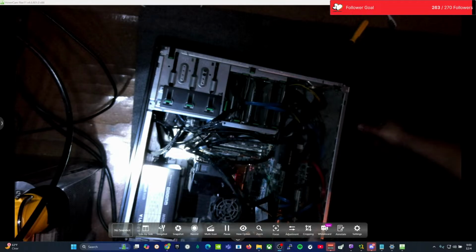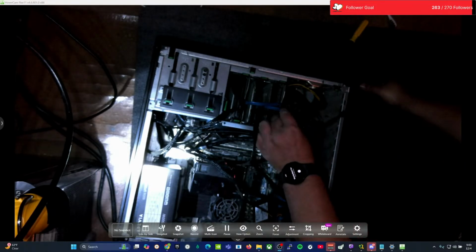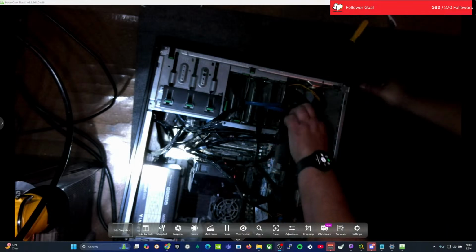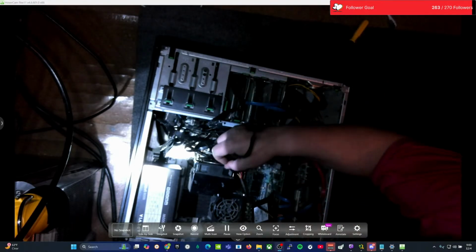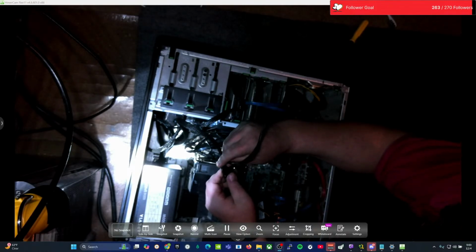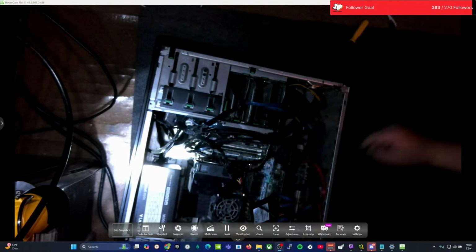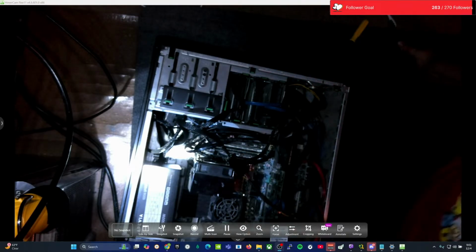It looks like we do. Okay, so we're gonna go this one here, this one here. Okay, there's all them drives, and then this right here plugs into this, which gives all our fans and the rest of our smaller SSDs power, like so. And that's everything. So now we're powered up, everything's rerouted, wired.